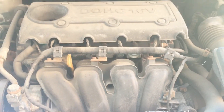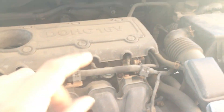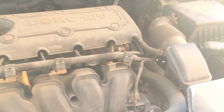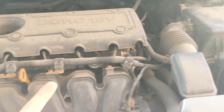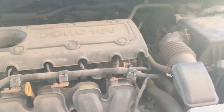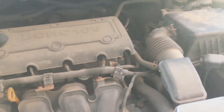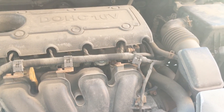In the case of a V-alignment engine, like a V6 or a V8, you would have one of two possibilities: a dual plane manifold with two intake plenums, one on either side, or one big manifold sitting in the middle in the case of a single plane manifold.